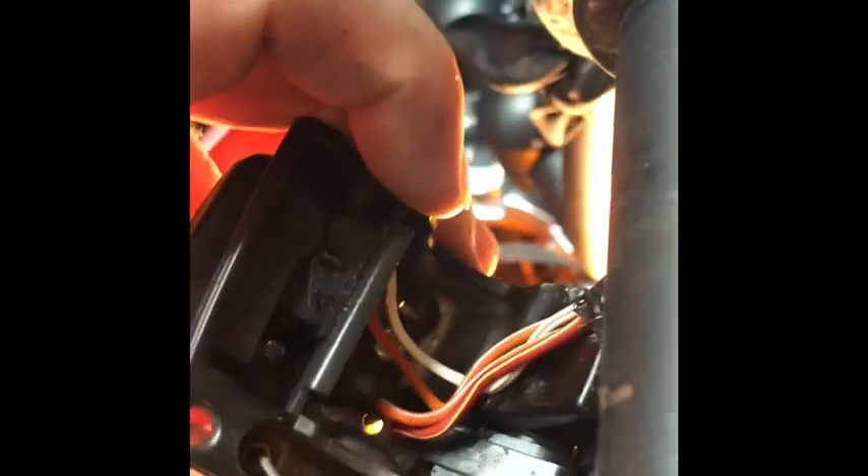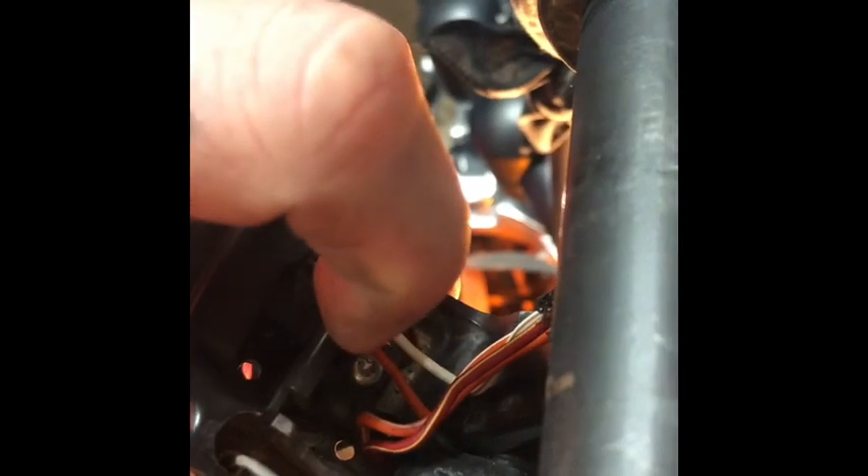As you can see right here, there's just what looks like a T25 or T27 screw right down there. That will loosen up the bracket that's holding in your brake switch. So I'm going to go ahead and do that and I'll be right back.